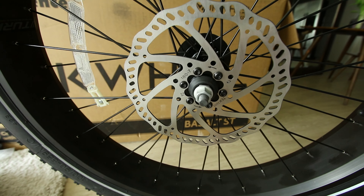The color screen gives you speed, trip, pedal assist, and time — very nice display. You've got pedal assist levels zero through five. There are no tab-over menus that I can see. The light switch is easy to operate — bright headlight and it turns on the taillight, which is also a brake light. Out of the box, it is a class 2 e-bike. Smashing the throttle brings us up to 20. Battery life is indicated by green bars on the screen — confirmed by the manual.